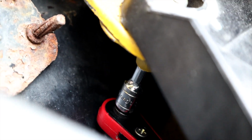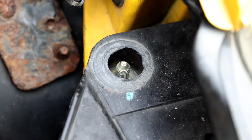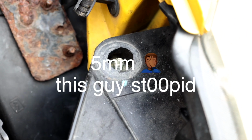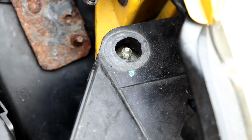So after a lot of work, essentially what you have to do is bolt it back up to full strength again, and you want to get a 15mm spanner or something like a ratchet on the actual stud itself to hold it in place. Once that's done, try to undo it with a 13mm spanner or ratchet again. If that doesn't work, I ended up having to secure it at the bottom with a 15mm ratchet, and with an impact gun on the top I had to just quickly give it a few bursts and it undid itself.